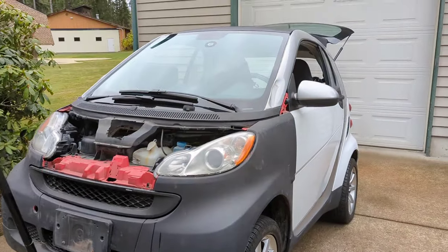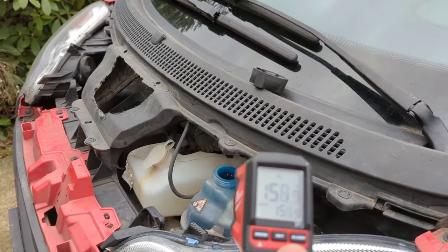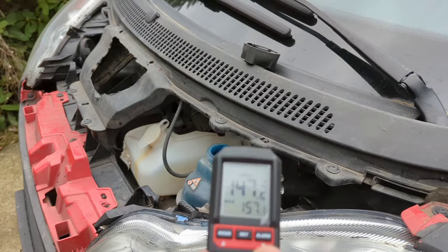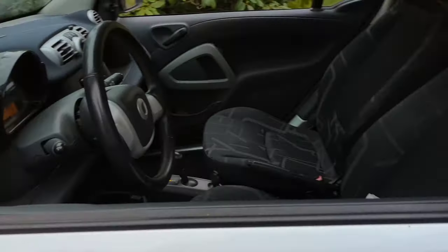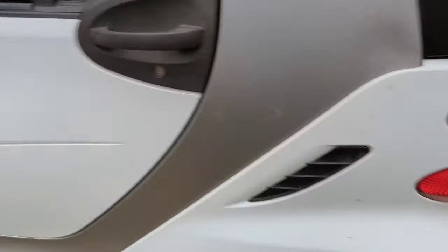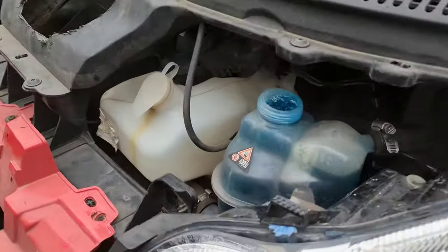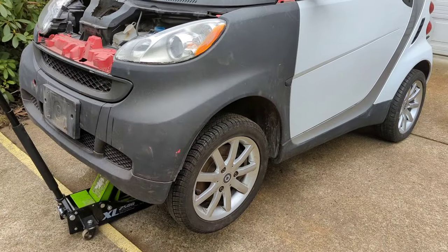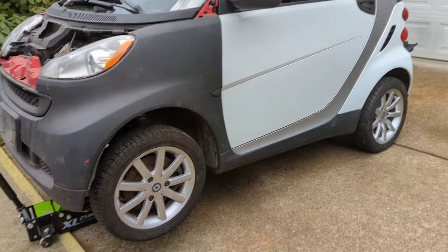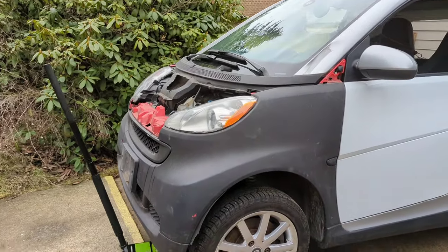It is now the next morning and I've got the coolant bleeding right now. Coolant's starting to warm up — 150 degrees. I've got no warning lights on the dashboard, which is a bit of a surprise to be honest, but it's running good. I've also bled the brakes and checked the torque on the wheels, so everything's good to go for a test drive as soon as the coolant finishes bleeding.